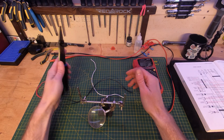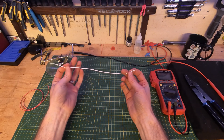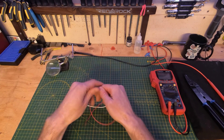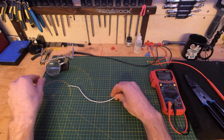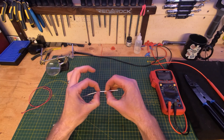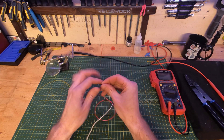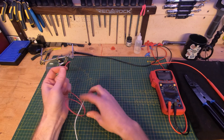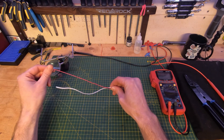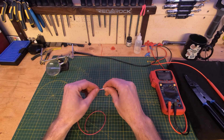Now let's talk about tapping into a wire and techniques for doing that. Once you find the wire you want to tap into — let's say this is the white wire and this red wire is what we want to get tapped in — you've got a couple of options. One of the ones I like most is the solder tap, where you take a little bit of the wire's covering off, strip the end of the new wire, stick it in, solder it in place, and then electrical tape it to seal it from the elements. That gives you a really good, secure connection.